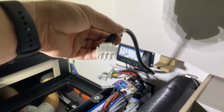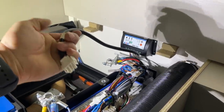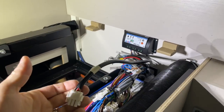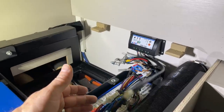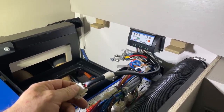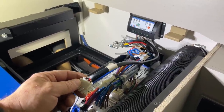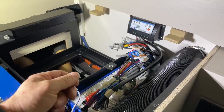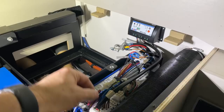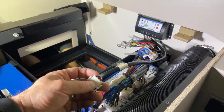This here with this connector on the EBL — I will next time remove the EBL from the equation. I would not connect a solar system through the EBL, because if I have a solar system with three, four, five panels running over the EBL, that is for me, purely from logic, a real energy limiter. The cables don't have the right cross-section through the various paths, and then the cable back from the EBL to the battery where the interior supply actually takes place — I personally find that not ideal. It technically works, but I don't believe you can draw the full energy from it.